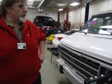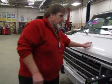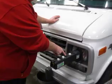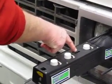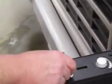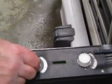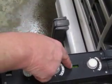The first thing I'm going to do, and it makes no difference what order I do it in, is turn my vertical adjustment here until I get the level vial in my unit centered in the middle of the 2 lines. So I'm just going to turn this, and as you can see, the level vial's moving in, and it is now between the 2 lines there. Okay?